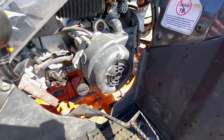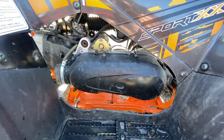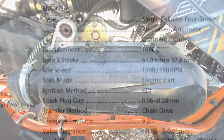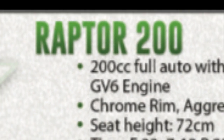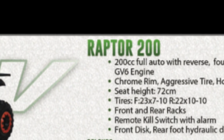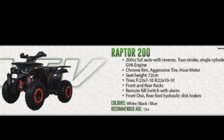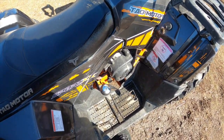We'll start right off with the engine. It's advertised as a Raptor 200, being a 200cc engine, although in the owner's manual it states that it's actually 169cc. But in the brochure it states 200cc. I'm guessing the 169cc would probably be the proper one. It is the GY6 engine and is connected to a CVT transmission with reverse.